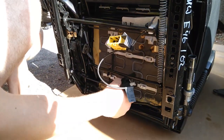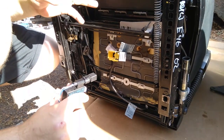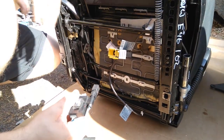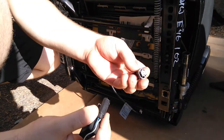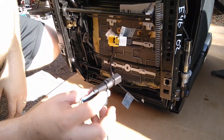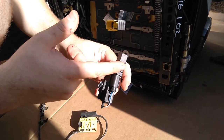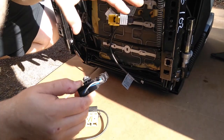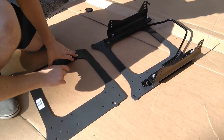You'll need to salvage this part from the passenger side seat too. This seat is from a British car, so it used to be a driver side seat — it doesn't have a pressure mat under the seat cushion. So you need to get yourself one of these delete plugs; I'll leave a link in the description. It's a really cheap resistor. You can make one at home if you know how to wire it up. The new Corbeau seat — or whatever bucket seat you use — doesn't have a sensory mat to detect if there's a passenger, so you'll need this. This is the base bracket we'll be attaching to the car, and this is where we attach the seat to.